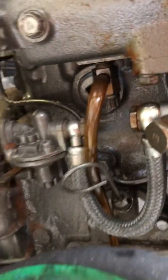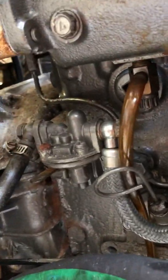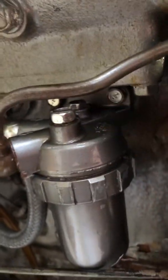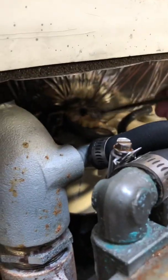The lift pump with the finger toggle thing to try to pump — that puts so little pressure. I can't imagine it working. I tried for probably 10 minutes of pumping total and never got a single thing out of that. But as soon as I opened that bleed screw and started pumping my primary pump fuel filter, perfect.